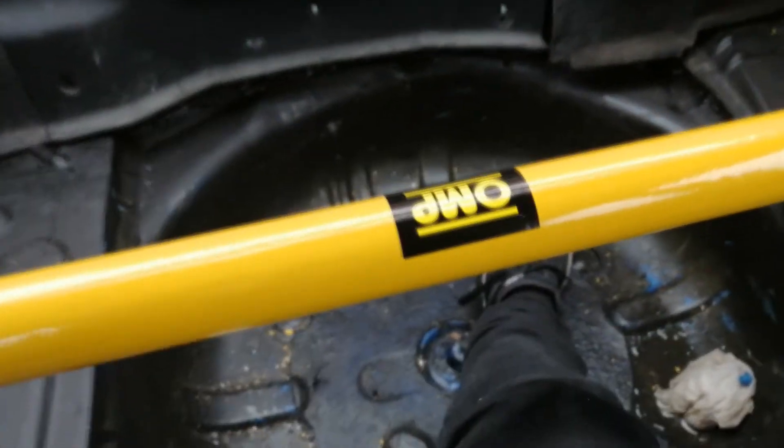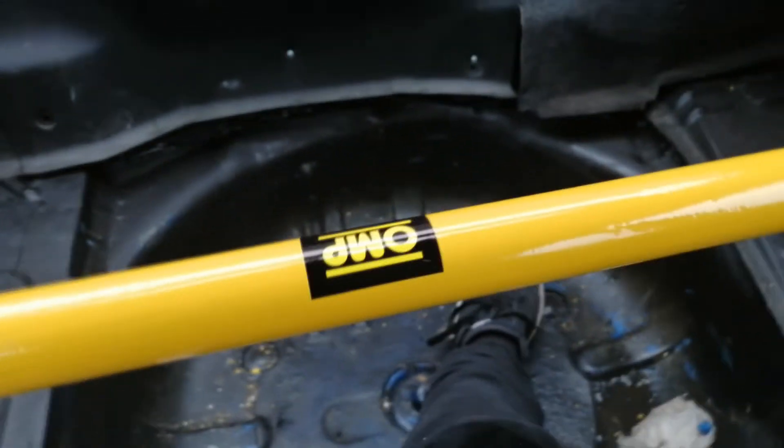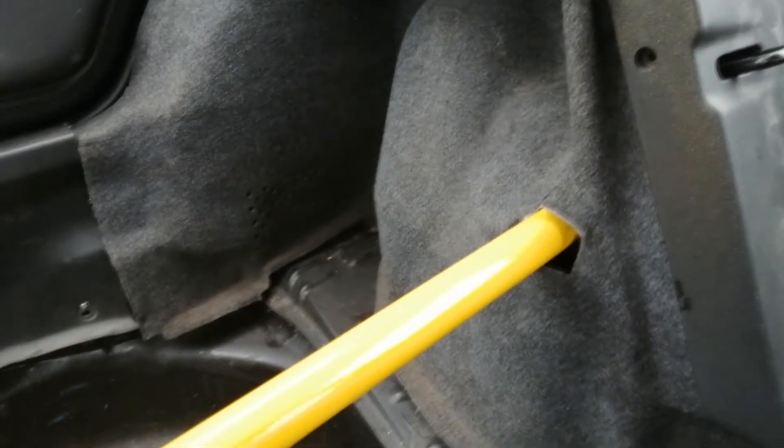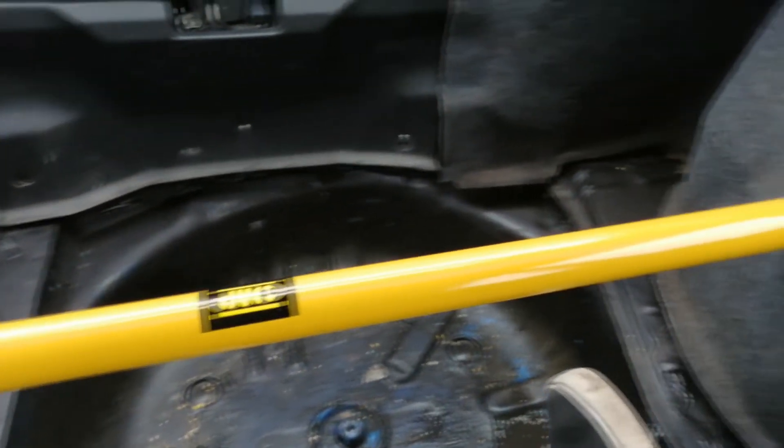I need to change that trim piece because someone wood screwed it into the metal, which is annoying. The half cage comes up to the B pillar and has an actual harness bar in it. I've seen people use strut braces as harness bars — don't do that. It makes your harnesses unsafe because if you get rear-ended the strut bar will move and your harnesses won't tighten up properly. If it's tied across a structural part of the car — the middle — then you're safe. If you've enjoyed this video, like and comment down below and I'll see you in the next one.